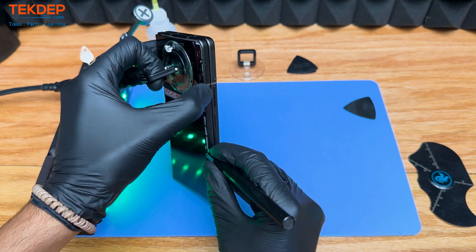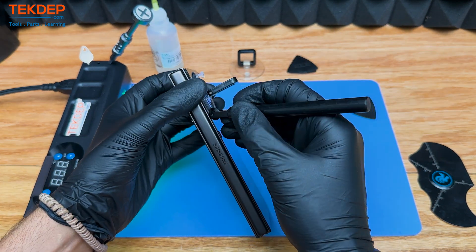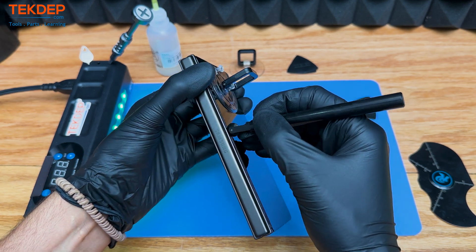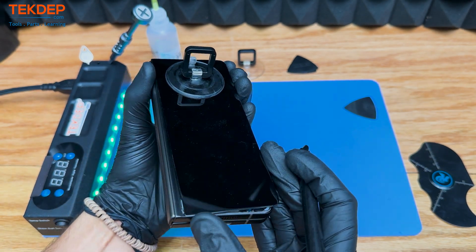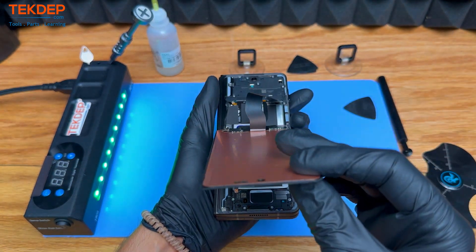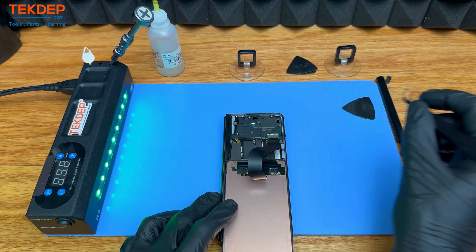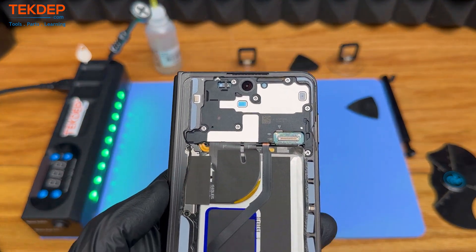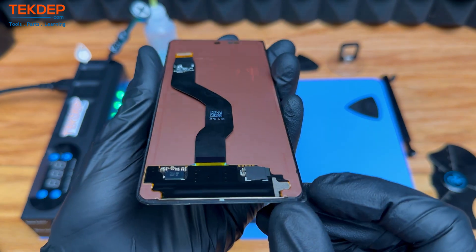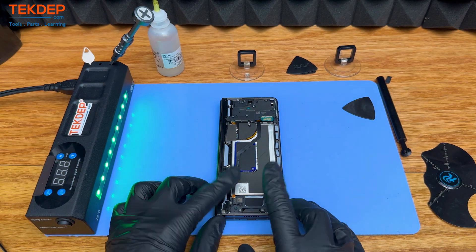So right now we're doing what we can to get that front 6.2 inch cover glass off without harming any of the cables — that's why you see that roller. We don't use the roller too often, but for this one we decided it was worth it. The suction cup is also key, and the screen actually comes down vertically. There is a flex cable attached to it that we are going to deal with, and then the screen will be free. It's a good-looking phone for sure — the internals look really nice, really clean. You can see that the screen is really not too dissimilar from the Fold 4; it's more or less identical.